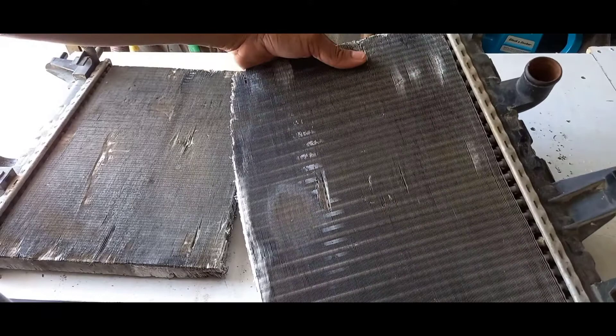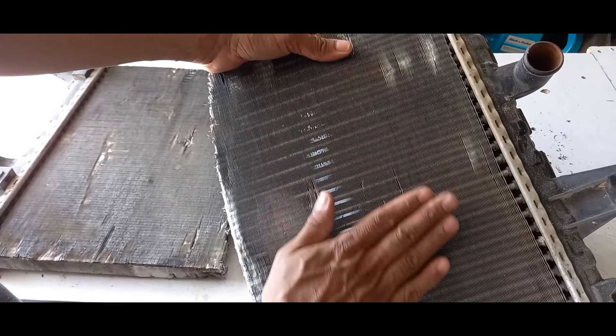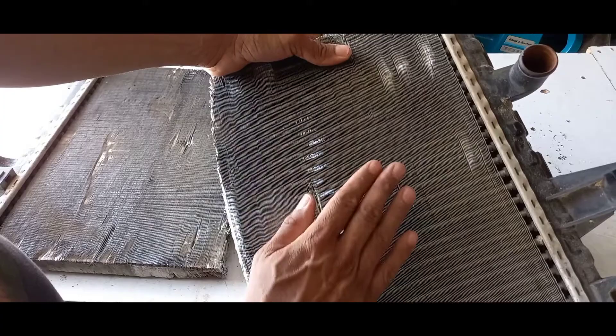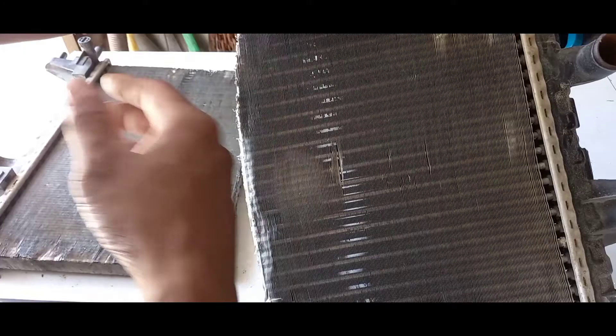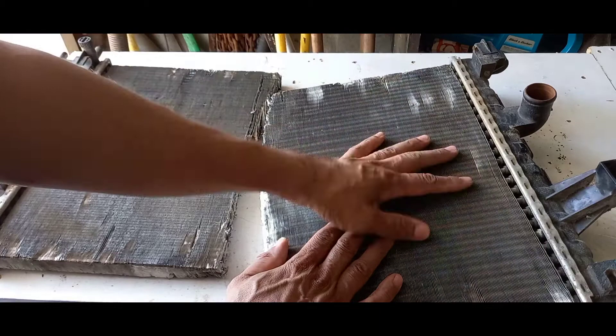What's very important is that you can still see through the fins of this radiator — that's a good thing. In some cases radiators are completely clogged up, and that can be one of the reasons your heat gauge goes up — the fins get clogged with dust and debris over time. It's important to inspect this and to blow it out or clean it with a medium-pressure hose, even just a garden hose will do. Give it a light brush and a good clean.